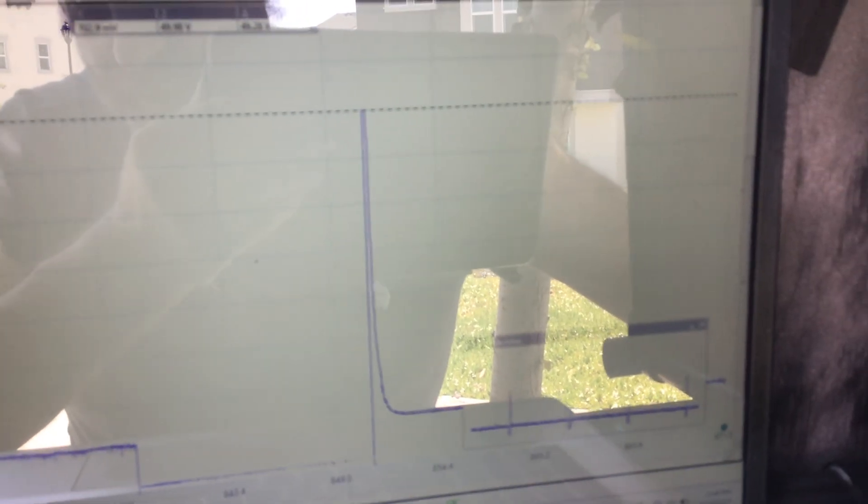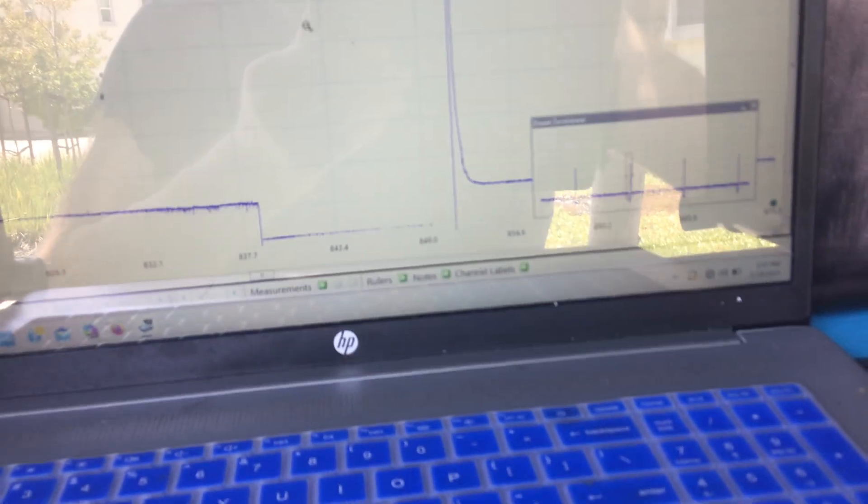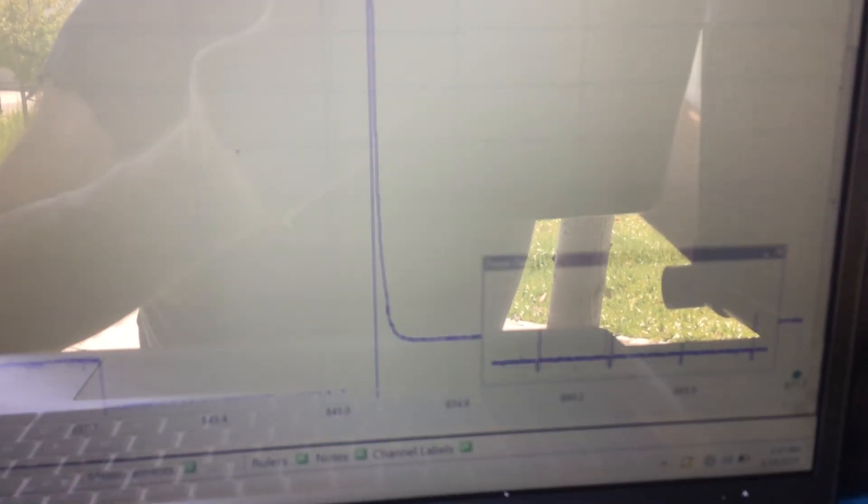The third number is the highest voltage — that's the peak spike or flyback voltage. That's pretty high. I'm seeing about almost 49 volts. I may be clipped because I didn't use the right voltage range. Whatever you saw on the Power Probe may be a little higher than 50 because I'm clipped. Nonetheless, that's a good flyback voltage, and it tells us we got a good dynamic injector with current flowing.